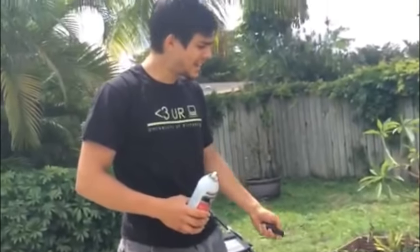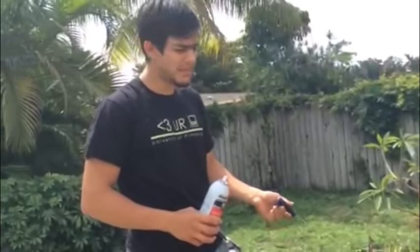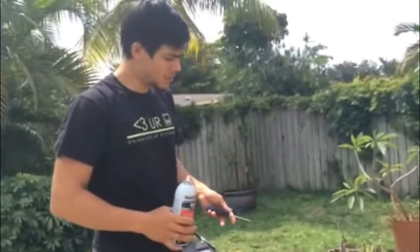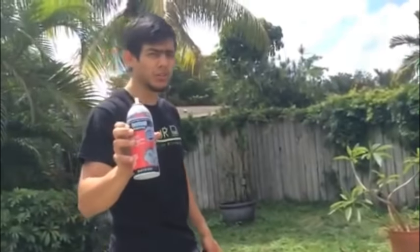What we're going to do is take this cable right here from the front wheel drive and make it into a stop cable. I cleaned out the carburetor, replaced some gaskets, and I put fresh oil in the oil tank, but still for some reason it's not starting. So what I'm going to do is use starter fluid.